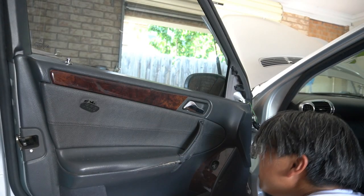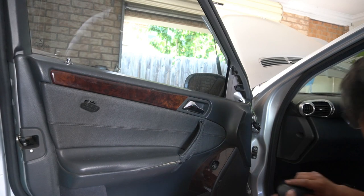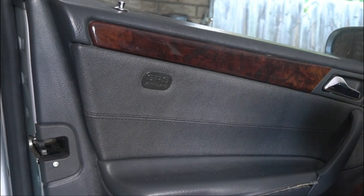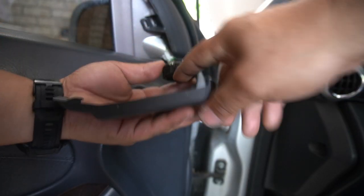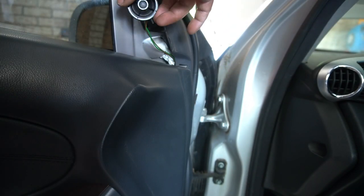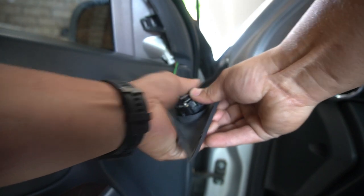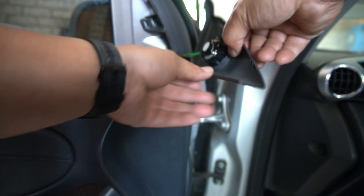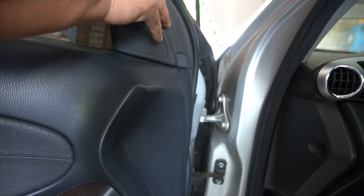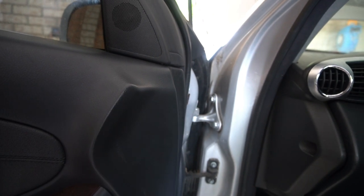There is also another one inside here — this is a T27. Lastly, we replace our door handle and it's clipped on. Push this back on, install our welcome logo again. For the tweeter, there are three tabs that hold it in, and on the tweeter you'll see three slots — line them up, ensure it sits correctly, line up the tabs with the grooves and push it right in. To reinstall the speaker cover, install this slot first, push into here, then push it forward — it has to sit in like that and then simply push it back and it clips on.